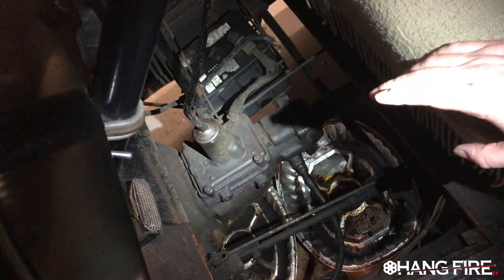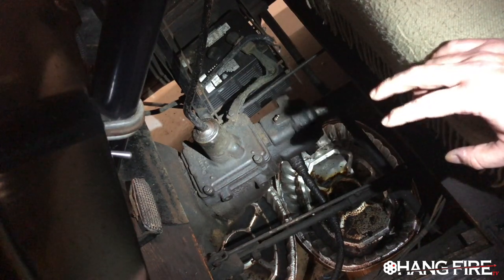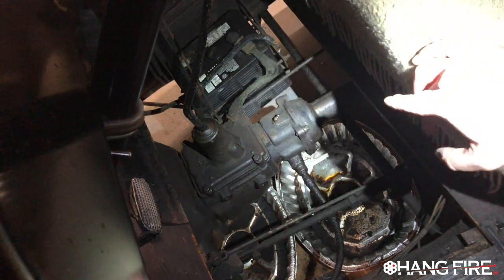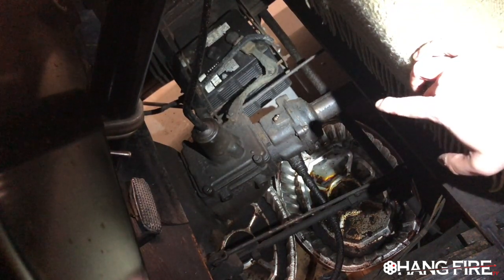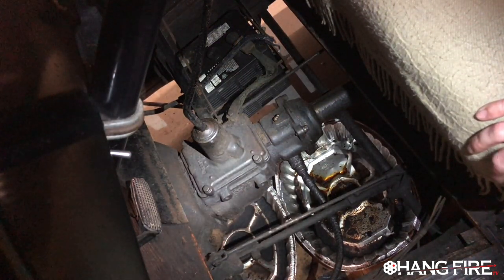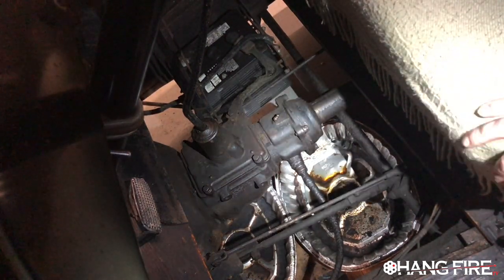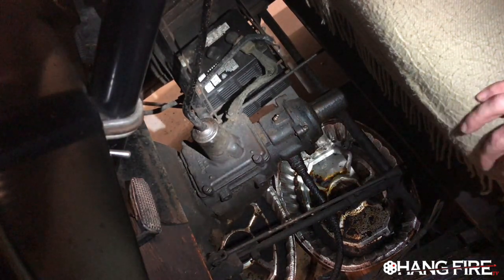Without the synchros, we just have a round cut gear, a square cut gear, and they just index with each other. And the only thing that's in there is some very, very heavy gear oil. And that whole shaft that has a drive shaft in it is filled with gear oil as well. So it's a pretty cool system. And it thermal cycles from front to back because that goes all the way back to the pumpkin. But a lot of this being 100 years old, it's probably going to be pretty leaky too. A lot of this stuff that's in it is really just leaking out of it.